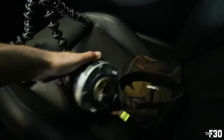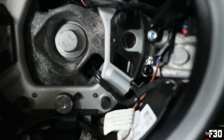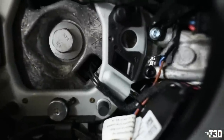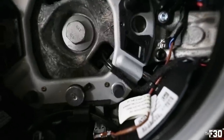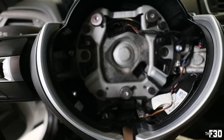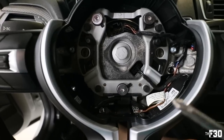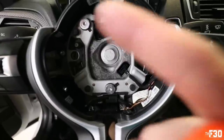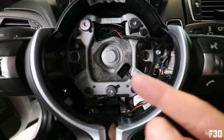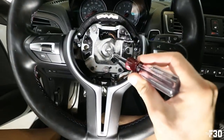Here is the inside of the steering wheel. The clip that you're releasing to get the airbag out — when you push in there, that's what releases the airbag. Do that on both sides and be patient with it. Don't start stabbing around; you only need to press it in. If it's not hitting and the airbag's not coming out, take it back out and find the right angle.